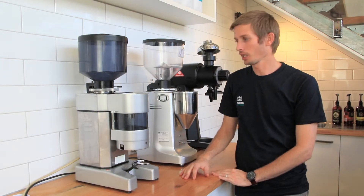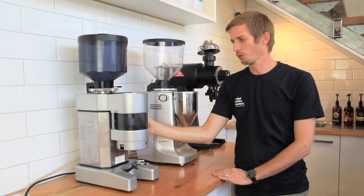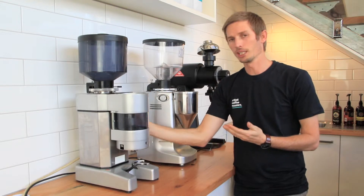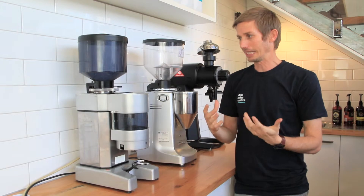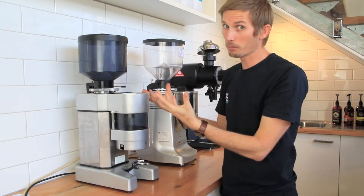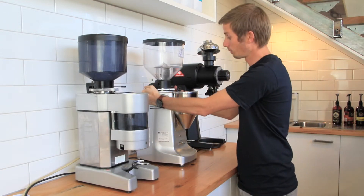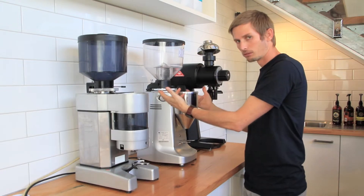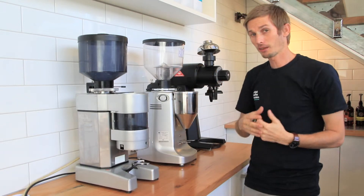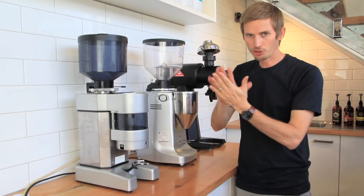The next thing to check is your grind particle size. What can happen is if we make an adjustment with the grinder motor not in action, we can jam down on the beans and jam the blades. This means when we try to re-engage our motor, it doesn't have enough power to unjam itself. The easiest thing to do is get the grinder collar and adjust it to a coarser grind. Go quite a bit coarser and then try to turn your motor on and see whether it will engage — same thing with this grinder here. I'd also recommend that if you're making large adjustments finer, have your motor running whilst doing this to avoid jamming the blades onto the beans.